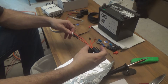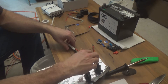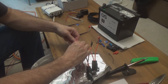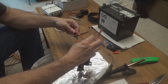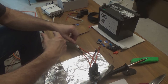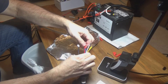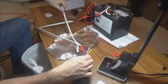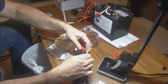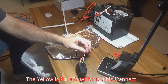Now I'm working on the wire that's going to run from the relay all the way to the battery. I've put my fused ends on my positive and negative terminals — these are going to be 15 amp fuses — and I've stripped the wires and soldered them together. I was going to use butt connectors but I just didn't feel like they were going to hold very well, so I went ahead and soldered the wires together and then used heat shrink tubing to insulate them. Now I'm going to do the other end that connects to the relay and solder those to the relay leads as well, so it'll all be one piece. I've got my relay wired up — the blue is going out to the radio, driving the power to the radio. They're both grounded into the relay. I've got power from the battery coming into the relay right here, and then this one here is going to go to my switch.